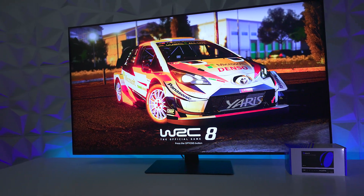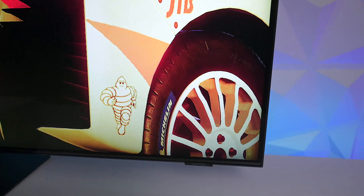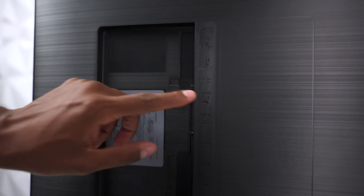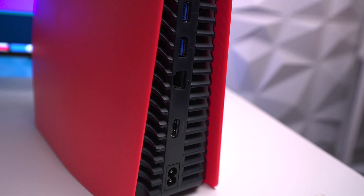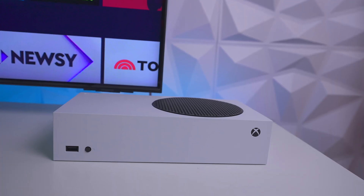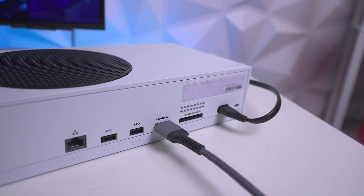To give you guys an example of how it works, I have the Samsung QN85, which is a 120Hz television that has one HDMI 2.1 input. I'm going to go ahead and plug the HDMI cable into the back of the television where it's labeled gaming. For source number one, I'm using the PS5 — I'll plug the HDMI cable into the back of it. And I'm using the Xbox Series S, which has an HDMI 2.1 output that can go up to 1440p using the proper cable, plugging it in where it says HDMI output.